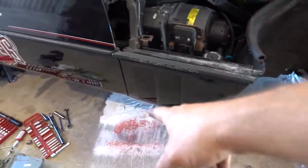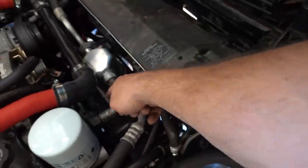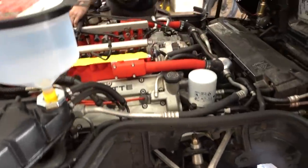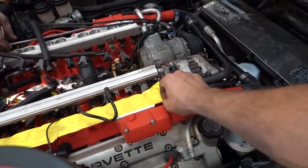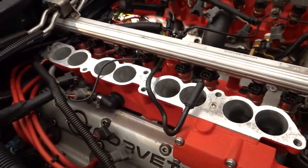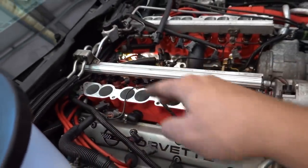We had a leak there with the gear oil and a leak here with the radiator fill that we did. I was filling all this up and it was leaking out of a little hose way down there — got it tightened off now. We got it filled full and we're kind of burping it and we're not leaking anymore, which is good. This is the first time we will be turning this motor over — we're just going to have it turning over for a while to get it all lubed up. We're not actually going to be running it right now, just spin it. The LT5 has four valves per cylinder, 32 total valves — two intake valves — and you can see there are two intake runners for each side.